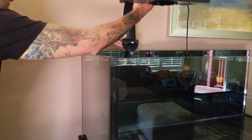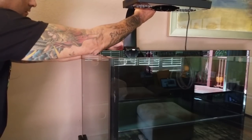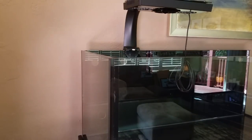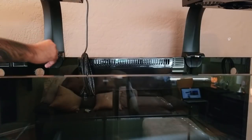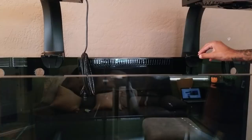I placed the mount over the glass and dropped in the clamp. From here I tightened the star nut on the back of the clamp. You'll want the clamp nice and snug but you don't want to over-tighten to avoid damage to your glass or your plastic rim. Once the light is installed, you'll notice the screw used to tighten the clamp is exposed and somewhat unsightly. These can be covered with the included rubber sleeves, which can also be cut down to length.